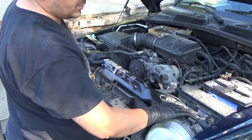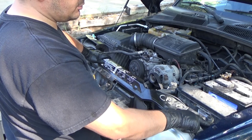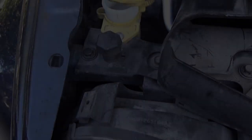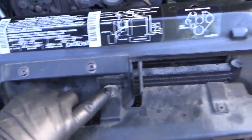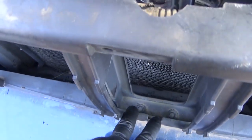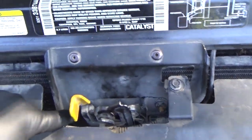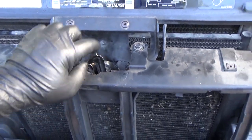Next, we're going to be pulling off this assembly, and there are screws, bolts, I'll show you here. I'll pull the camera off the tripod and show you, but there's one here, here, here, here, this one here, and there's two down here. So let's pull the camera off the tripod and look. Okay, right here, here, here, here, here, and the two down here. Those are the 7 bolts that we're going to have to take out to get this assembly off. And then in addition to that, there's 2 nuts, one right here and one right here. I'll walk through that here in just a second on what we're going to do to pull this latch assembly out.